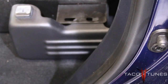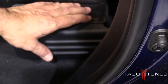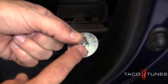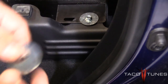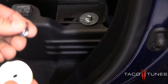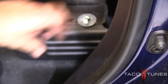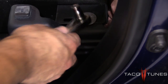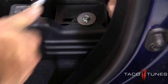Here you can see we've got the bracket in place and it lined up really nicely. I'm going to take my 10 millimeter bolt, put my fender washer on top, then take my other fender washer and my flange nut and attach it from the bottom. Got that one on the first try — usually I drop the washer! Now I've got my 10 millimeter ratchet and a wrench on the bottom and I'm going to tighten this up.